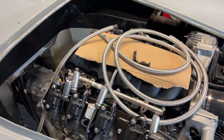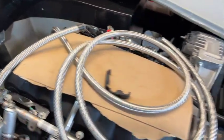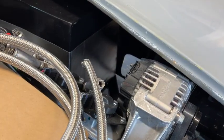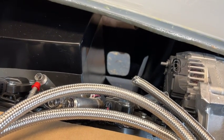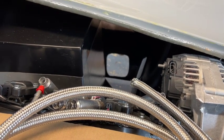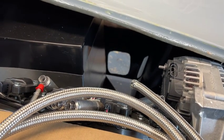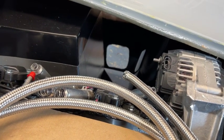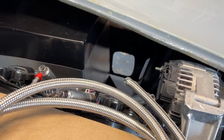The body is on — it looks like we're on the home run, but there's still plenty to do. Before the body went on, I lined the engine bay with heat reflective sheet, much easier to put in nice and neatly and square all around here, and down where the cat comes in and the exhaust exit. I also sprayed the inside with VHT — very high temperature paint for fiberglass — and I may also line the inside with the heat reflective sheet to save the fiberglass from heating up and possibly bubbling the paint on the outside.